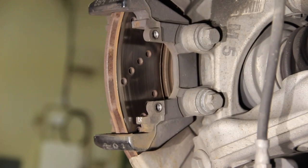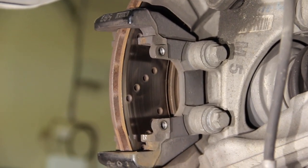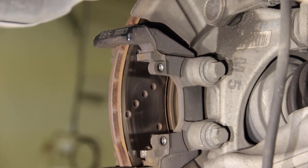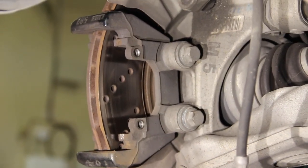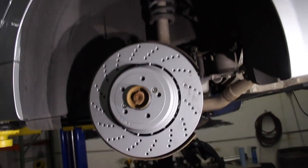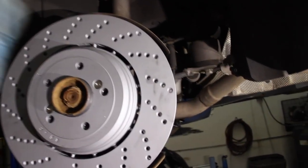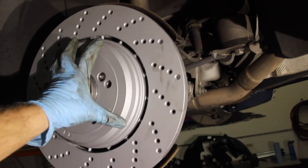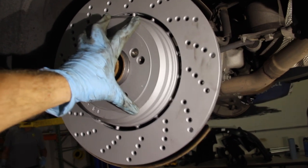Here on the backside, the bolts that hold the caliper carrier onto the rear wheel carrier area are 18s, just like the front, but we're very close to the wheel carrier and the axle assembly there. So I've used an open-ended wrench, which worked very well, and then once they get loose, I was able to unthread them by hand. Getting this rotor off was, for some reason, a problem - I've already done the other side and it was the same thing over there. Make sure your parking brake is released. If you have your parking brake on, there are shoes in here that expand into this drum and will make it almost impossible to take your rotor off.